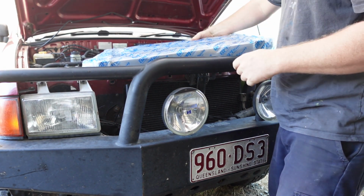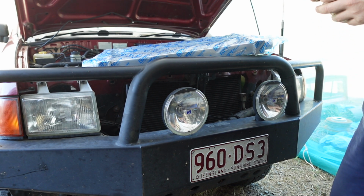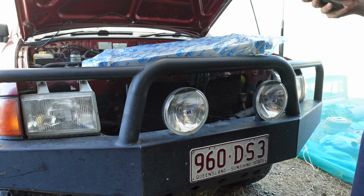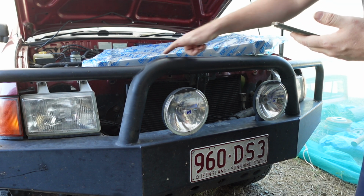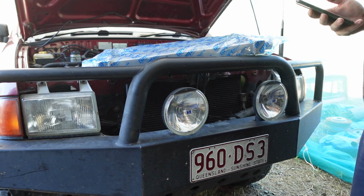But it's a GPI Racing. Ooh, let's just balance it there. It's a GPI Racing intercooler. Yeah, Wally Cooling. So this one's a 40mm thick one. She's 550 by 230, so it actually fits in there quite well. When I bought it, it actually had pictures of mounts on here. That went significantly well. I ended up contacting good customer service.